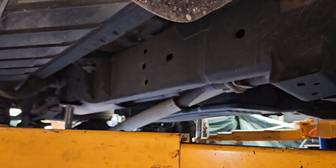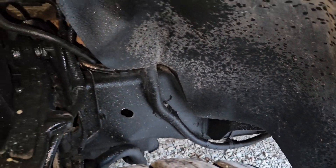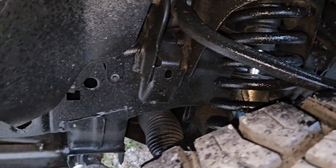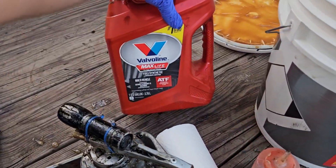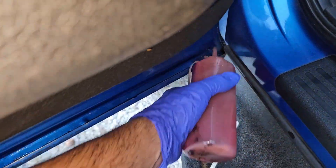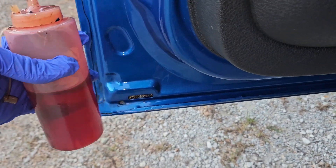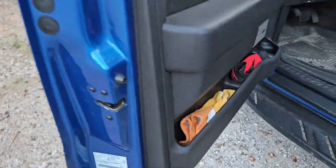Here are the results — I just hit the high-traffic areas with fresh film and gave a light coat over everything else. It's ready to hit another winter. Here's what I use for the doors: I get normal transmission fluid, put it in a little ketchup bottle, and come over and hit all my doors and tailgate. I just make a light bead across the whole seam at the bottom of the door, and that transmission fluid will creep up six to eight inches inside the bottom of the door and prevent them from rusting out. That's it — see you next year.